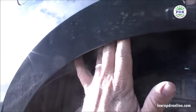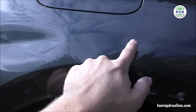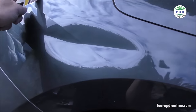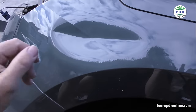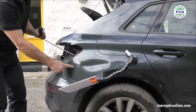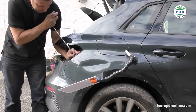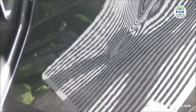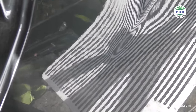Taking the screws out of the undershield - I can't quite show it on camera, but there's a hole up on the inside of the arch. With that access point and this access point, I know I can reach the majority of the dent and I intend to glue pull all of this. I'm going to start this repair from the back end. I've got a hockey stick style tool with a blade tip going right through that access point to get me on the back end of this crease. Taking out the crease damage to the left and right of the main bulk of the dent, making sure all of the tension is where I want it - right in the middle, ready to rework that body line.